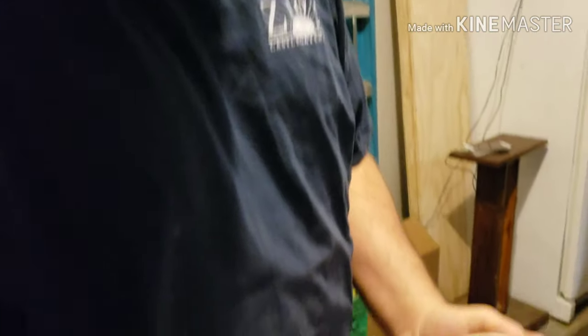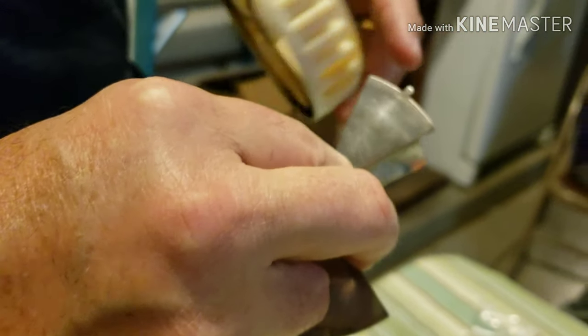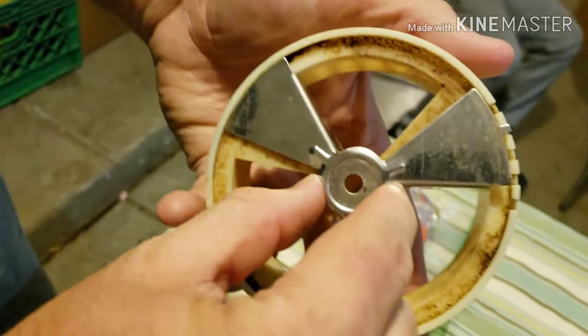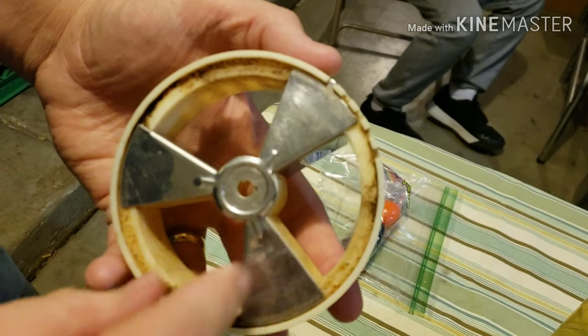All right, I think you did a pretty good job. I did notice one thing that he missed. On this piece right here, there are these grooves and this metal piece will actually come out — you can see it has a little lip right there. What that will do is determine the size of the hole where your candy comes out. If you put it there, it's a smaller hole; if you move it over here, it's a bigger hole. So depending upon how much candy you want to dispense, or if you're doing toy capsules or gumballs, you can adjust that to your liking, however much candy you want to come out. So other than that, that's the Northwestern machine. If you have any questions, please put a comment below. If we did something incorrect, put a comment below so that we can fix it.